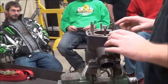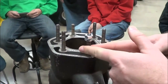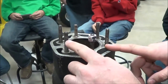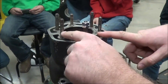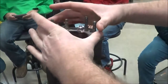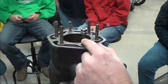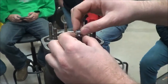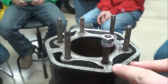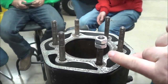We're going to demonstrate how to remove a stud, focusing on cylinder studs for a two-stroke motor — but this could be done on an exhaust manifold, intake manifold, it doesn't matter. A stud by definition has threads on both sides of the bolt. The idea is that it stays in the piece of equipment, and we thread and unthread fasteners off of it. They're typically in there pretty tight with some Loctite, or they're an oversized stud where the bottom threads are larger and dig into the cylinder. We can heat these up if needed.